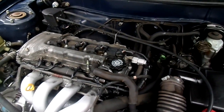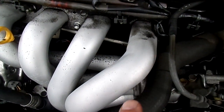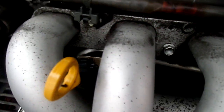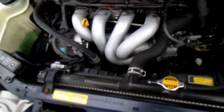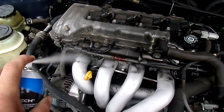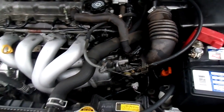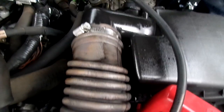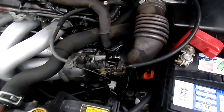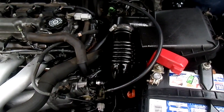Obviously we're going to take off the engine cover, which I've already done — on a Corolla it's just a little plastic cover with two ten millimeter bolts. We want to concentrate our efforts right here on this intake. It's a nice aluminum intake, so we want to verify there's not an intake leak. It's real simple — just get some carb cleaner, brake cleaner, whatever, it doesn't really matter. We're looking for any change in the engine. Not hearing anything from there. Next, I'm going to try from the throttle body right here through the air breather and see if we have any leaks — it looks nice and solid, no problem.